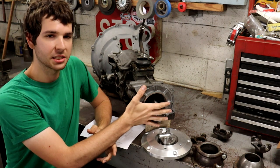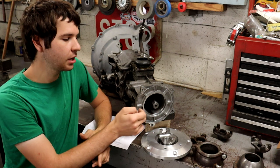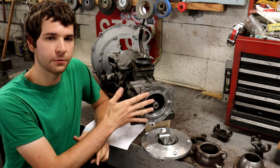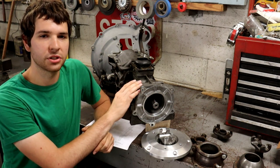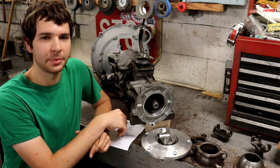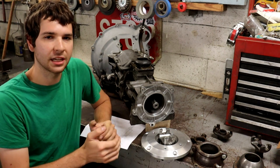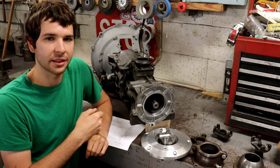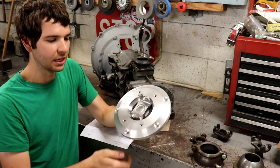You can tell because it has this big flange on the back here where the transfer case would originally bolt to. But I'm going to be using this to adapt it back to the early Ford closed drive shaft. Most people just use the two-wheel drive transmission and then run an open drive shaft. But I didn't want to do that because I wanted to keep the compactness of the closed drive shaft. It takes up a lot less room, and I don't need a four-link suspension or anything like that in the rear. So in this video, I'm going to be showing you how I designed and built this